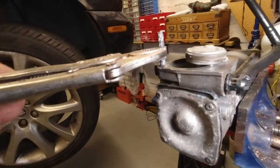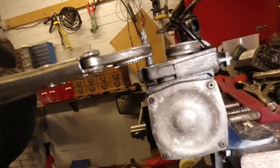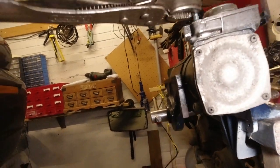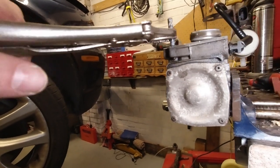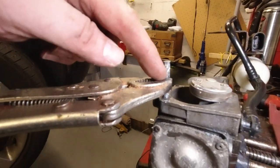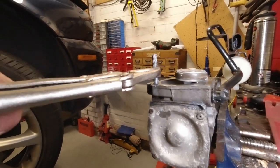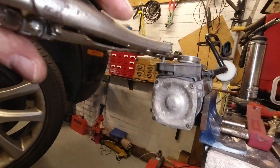Yeah, that's going to be stiffer as it comes out. That'll be a little bit of throat at the bottom that's exposed, pulling into the hole. So, give that a little bit of lube. There's no point pulling so hard that you make the grips slip, because once they start slipping, you start spalling the metal and then there's nothing to grip. Right, there we go.